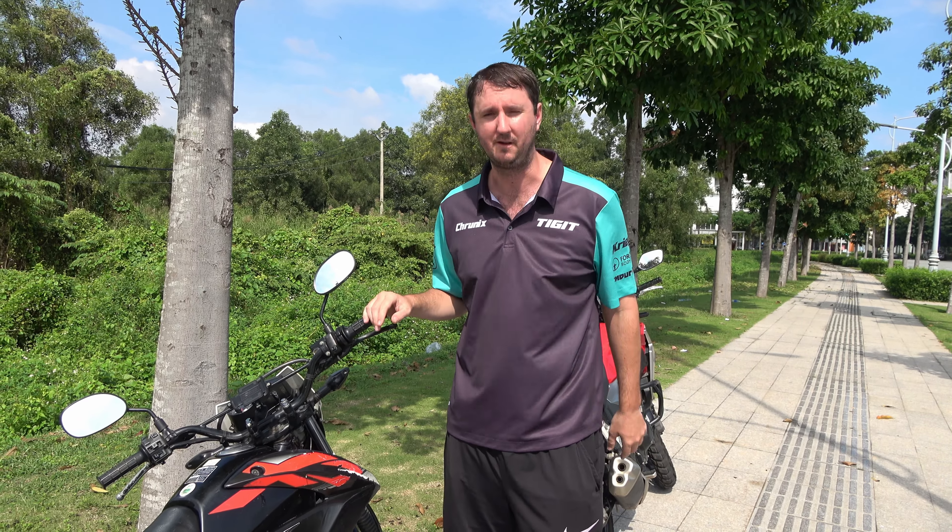Okay so we're going to unscrew it. We're going to clean it with a rag so it's nice and clean. Now let's be real — you're out there on the road so you've probably only got a tissue. Whatever works, your t-shirt will do. You really do want to try not to get this dirty or avoid getting mud in here. Now we're going to screw it all the way back in and make the bike level, just like we talked about with the CB.